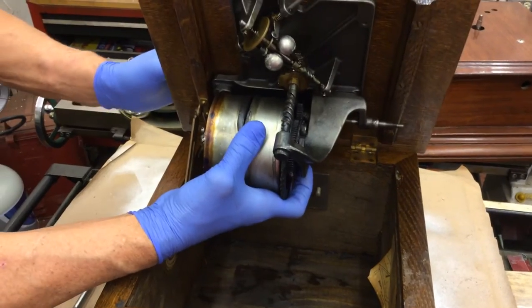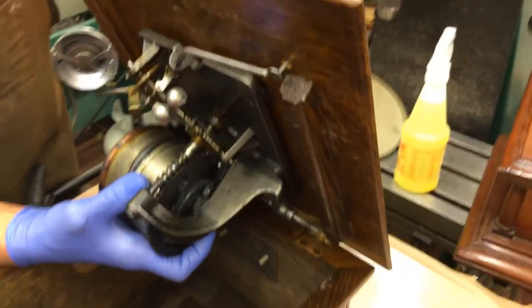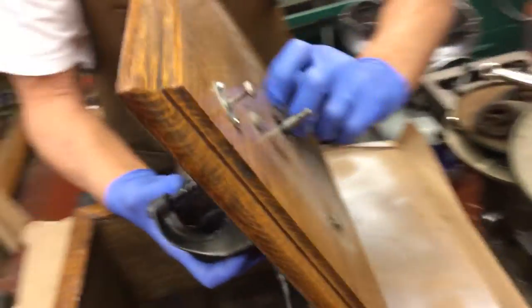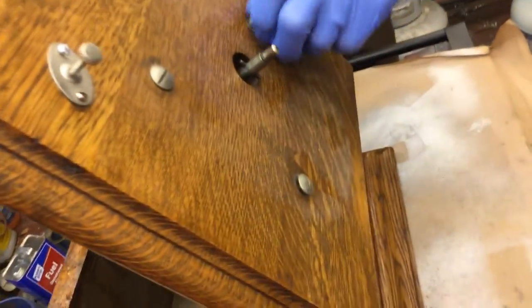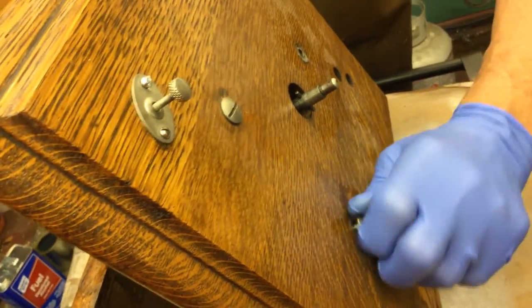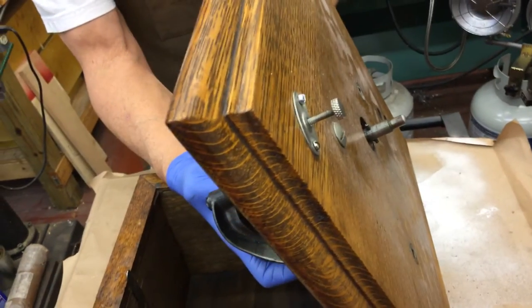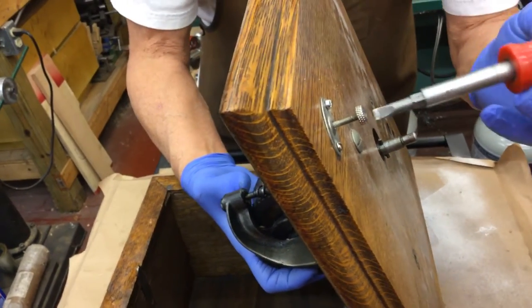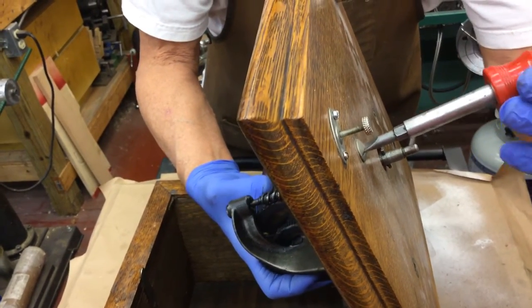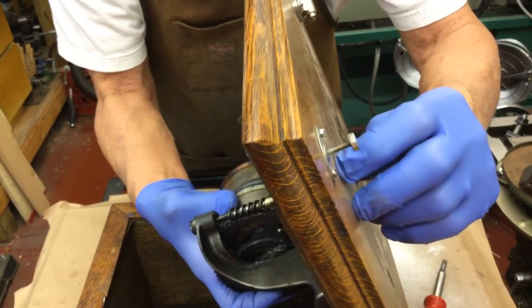What we're going to do is take our hand and push the motor against the motor board, and we're going to unscrew these screws. While we unscrew these screws, we're going to drop them in the cabinet. They should unscrew easily. If they don't, you're going to have to have a screwdriver. We're down to the last one, right here — this is the one that's holding the motor in place. We're going to move the motor and wiggle it around.